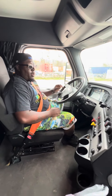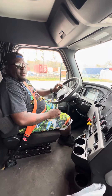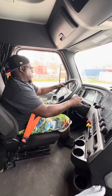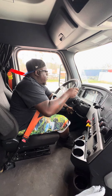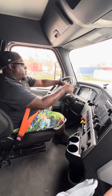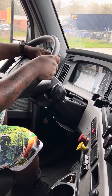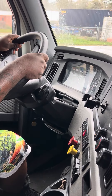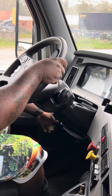It's a little different from the old NCAP. We're going to start by doing the safe start. Make sure our buttons are pulled up, our truck is in neutral, and turn the key to the on position. Check all light indicators on the dash, make sure they all illuminate, and check the ABS light on the truck and trailer — it went off in three to six seconds. That's how we start our truck.